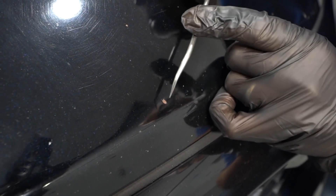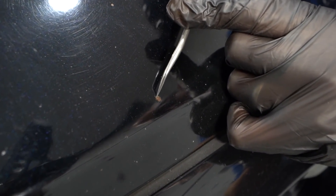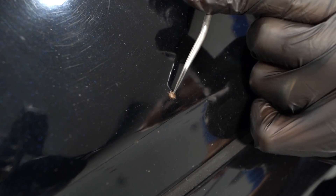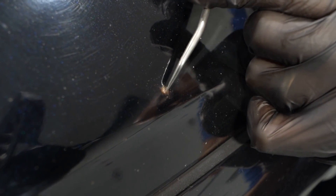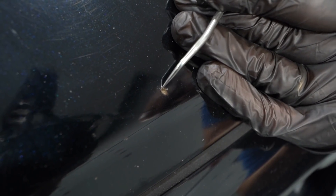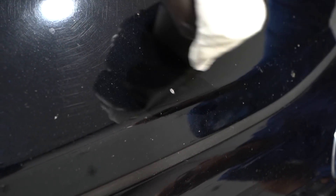But a spot like this, we're going to have to scrape out some of the rust. You can either use a pick like this, or if you can find an extremely small wire brush, you want to scrape as much of that rust out as possible. If you were to use sandpaper, it's not going to be that easy in a small spot like this. So do the best you can.